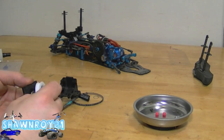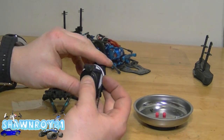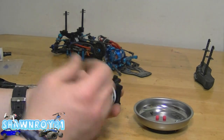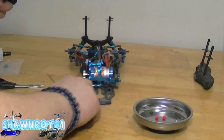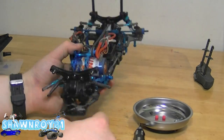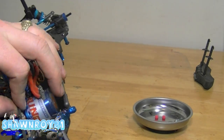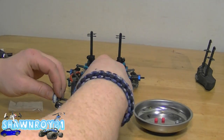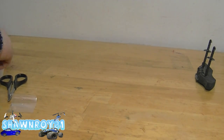For the bulkhead, we install the one-way with the retainer, get our belt lined up, put that back into the bulkhead - four screws to get that all set up. Now we're adding the sway arm retainer back onto the chassis, as we did remove it earlier - two more screws for the chassis brace and get that pulley lined up. The pulley we're using this time is an 18-tooth, which is going to give us a 1.2 counter-steer ratio. Make sure all those flange bearings are in place - they love to fall out when you're working on those pulleys.